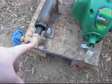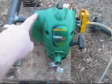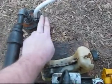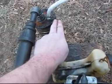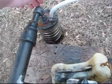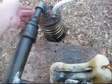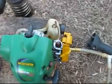What I'm doing is using the vacuum of the engine to pull air through this hose right here. This nozzle right here is cut off right at the top, and this one goes all the way to the bottom, so air gets pulled through this pipe down to the bottom, which bubbles the gas up into a vapor which gets sucked back into the engine.